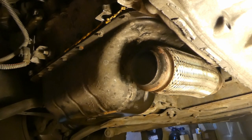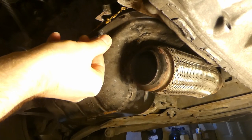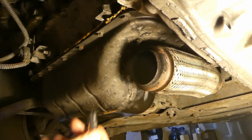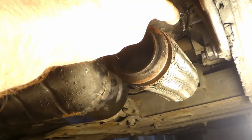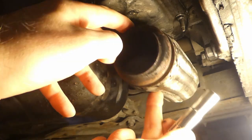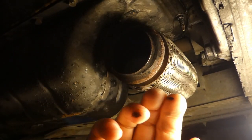It's not really that difficult. You would need 8mm for these bolts - so this is an 8mm small socket. But there are two problems actually. One is there is this one stud here that is actually a 10mm rather than an 8mm. And there is this flexi - it's actually a flexible exhaust side. That's not that much of a problem, although this stud has a shoulder underneath the sump.